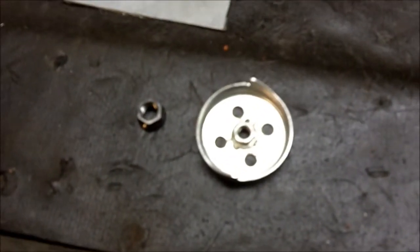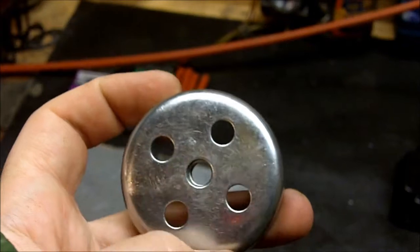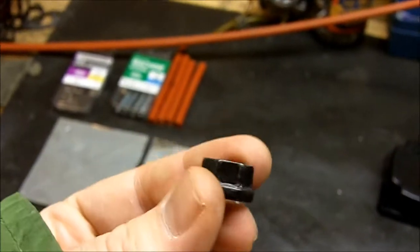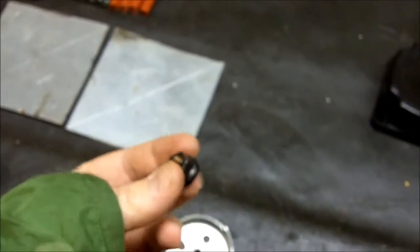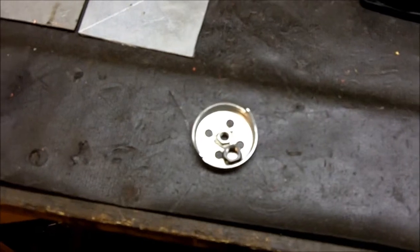Here's how I plan on rigging up the pawl. You can see there are a couple of welds holding the nut into the center of the pawl — I'm just going to zip those off with a grinder, pop that out, then drill it out with a bit big enough so I can fit the threads of the crank through there. I found this 11 millimeter nut — Toyota actually used these on some of their older models and you can get them at your local Toyota dealership. So I'm going to replace that welded nut with this guy, and it'll get mounted on the edge of the crankshaft, taking the place of that Doppler variator nut.